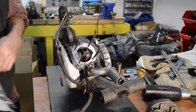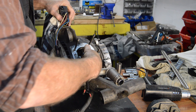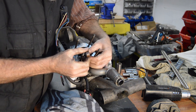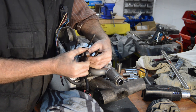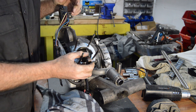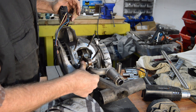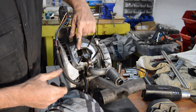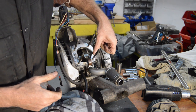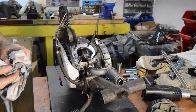So it is looking like this engine has had some work, definitely. Let's pull our conrod up and down — there's nothing in that, not anything. Very good. That gasket looks brand new as well. Cases have not been ported — they're standard.